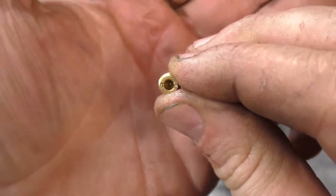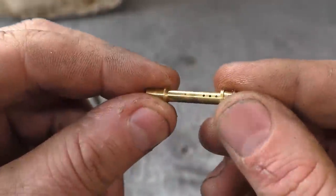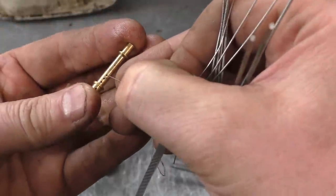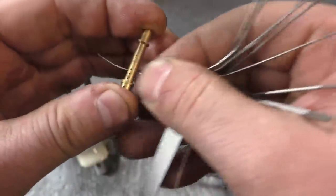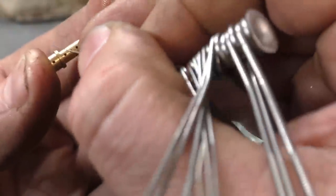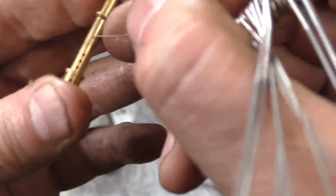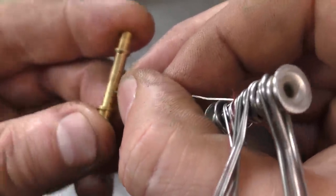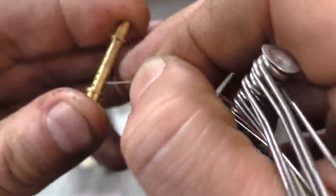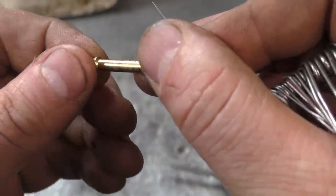You cannot see daylight through it, and that's the problem. Usually the emulsion tube will be fine - you can see right through it and all these little holes. What I like to use is some torch tip cleaners, and I run them through all the small holes here on the emulsion tube. Sometimes I even enlarge the holes just a bit because all these gas engines run pretty lean. There are even smaller holes here that you can clean as well. Just run the torch tip cleaners through all these little holes, and sometimes I run it on the wire wheel just to clean the emulsion tube.